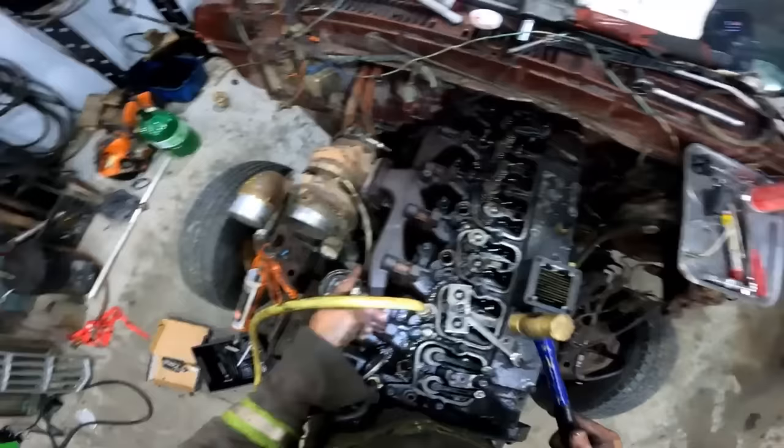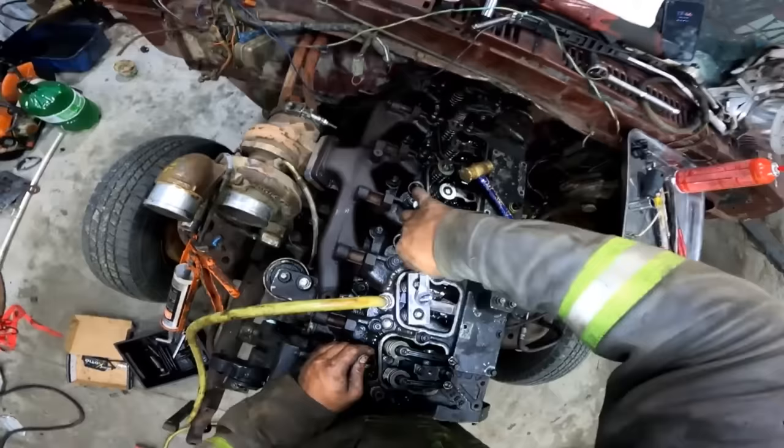Now if you hear it coming out of the exhaust side, you know that the exhaust side is getting hung up, but that seems pretty good. Sounds good anyway. Yeah, it's not hissing. All right, tighten her all the way down here.